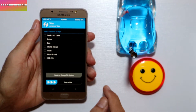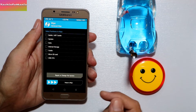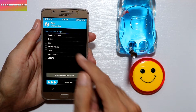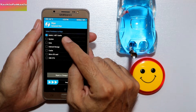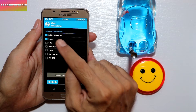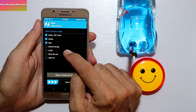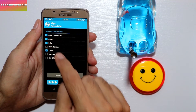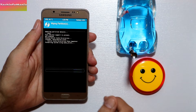Make sure you copy the ROM file to your internal storage or your micro SD card. In the Wipe and Advanced section, select: number one — Dalvik/ART Cache, number two — System, number three — Data, and number four — Cache. Leave the internal storage unchecked. Select these four partitions and swipe to start wiping.